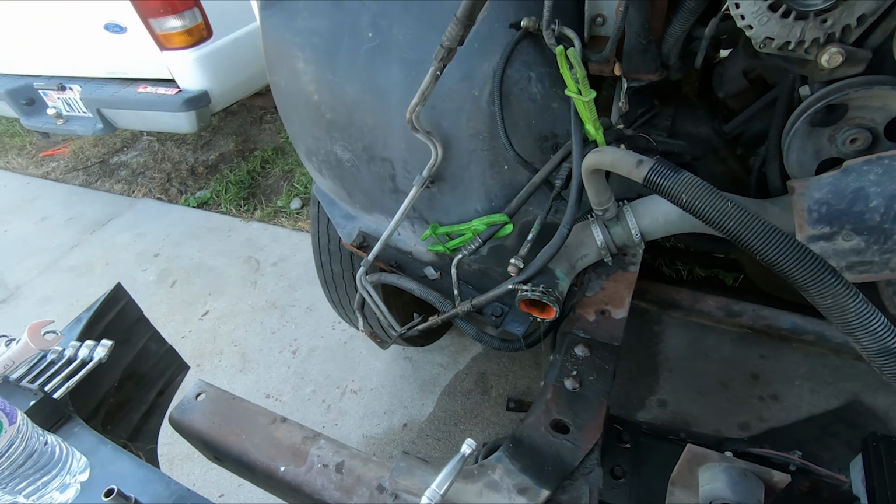All right. Got my cherry picker out on half ton because, man, whoever thought a Cummins might not fit in here? This thing goes deep, so it might not fit in here, but it's deeper than I thought, so I don't think I'll have a problem getting my Cummins in here. That's as far back as I can go. That's almost centered in the middle of the engine there, so with the chain, I should be able to pick it up pretty straight. In fact, I have a leveler. I might grab it with that.